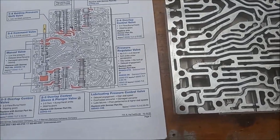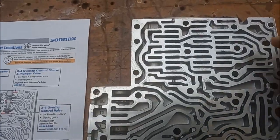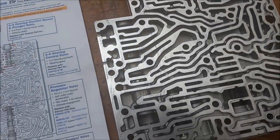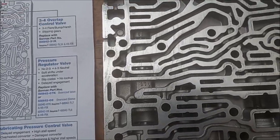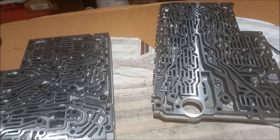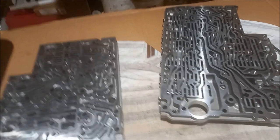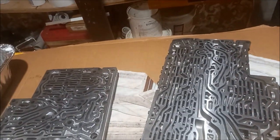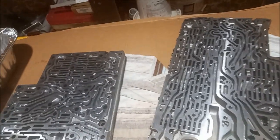So that turned out all good. They're all solid readings. Just the one up here was about 23 instead of 25, so that's all good. This is worth keeping. So yeah, that seems all good. So I would advise that if you're going to do the conductor plate, you might as well do the O-rings on the solenoids as well, because I think that would be where one of the problems is.